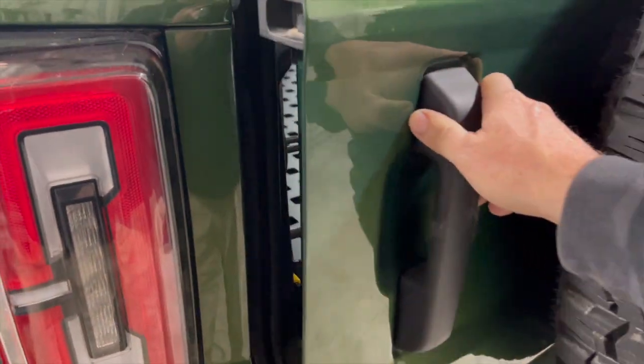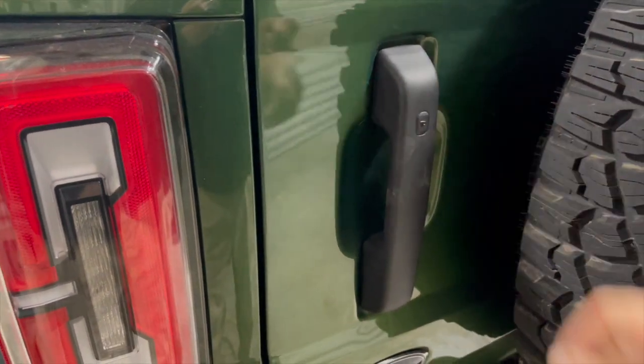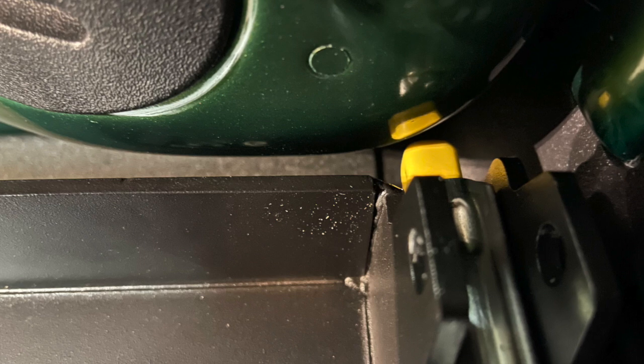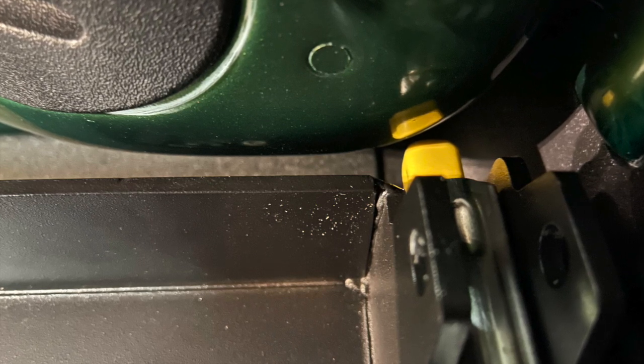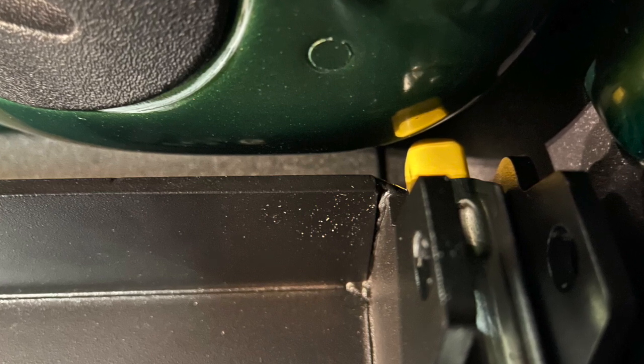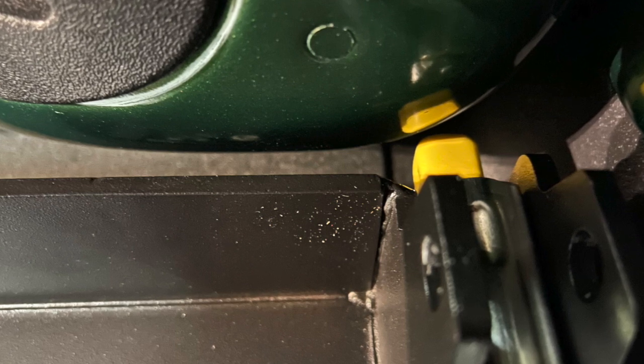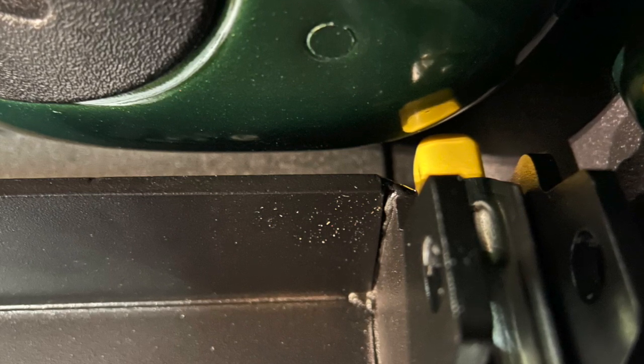Check the interior clearance between your Packhorse driver's side release handle and your tailgate. Gently close your tailgate and check for clearance interference from the inside. The Packhorse release handle on the driver's side should rest just below the curved portion of your tailgate assembly. If there is any interference, shift your entire Packhorse assembly slightly to the driver's side and resecure.